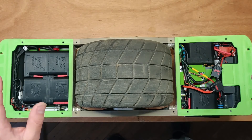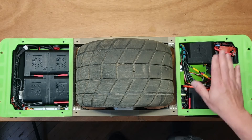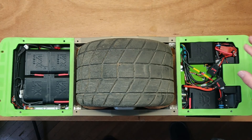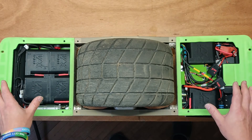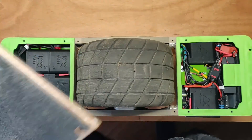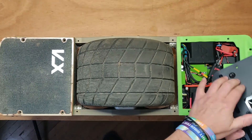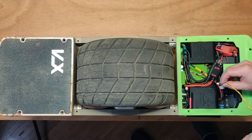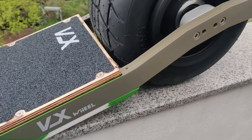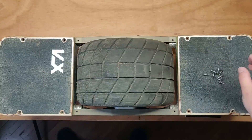I'm going to assemble it now and go for a ride. Before you plug in any power again, check all of the connections — make sure you do it twice or three times. It doesn't hurt to check the wires twice or three times, because it does hurt when you melt your expensive components. Once you're sure everything's connected and your battery is acting as one big pack, only then you can safely connect it back, install the footpads, and go for a ride. It's also good to use some foam to press the battery down so it doesn't shake. Don't forget to connect your footpad where it belongs. Thanks for watching, I hope you learned something today. That's the VX Wheel 4-Bolt, which I'm going to release all the details about pretty soon. Let's install the screws and go ride.